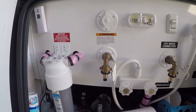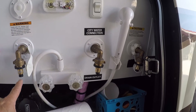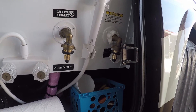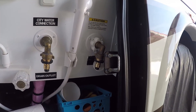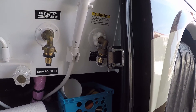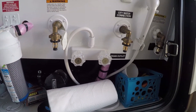This is the wet bay area. I have quick disconnects on all of my different connections — onboard water, shore water, and also for a quick flush. I've hooked those into my hoses so I just pop them on, snap them in, and they work real good. On the hose I use for the black tank flush, I have an anti-backup valve to keep any backup water from going into the water system. These quick disconnects are really nice to have.